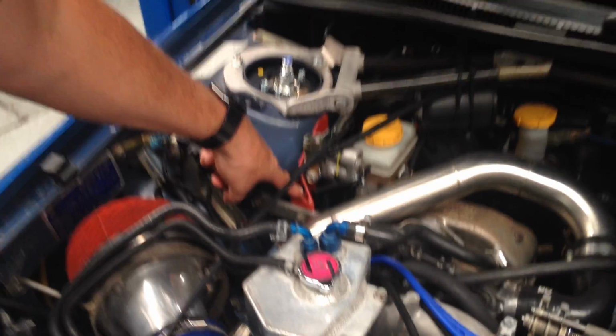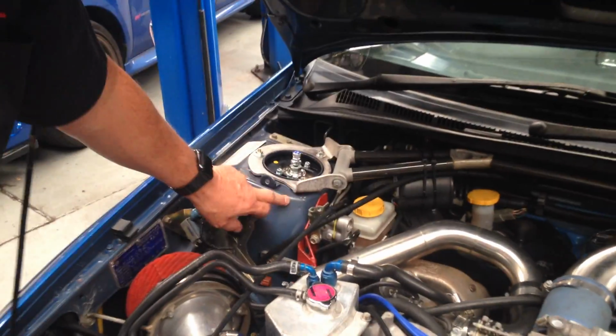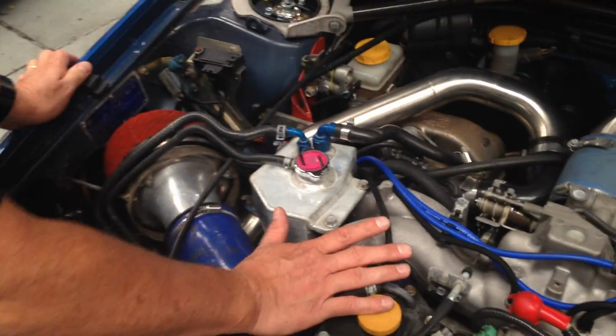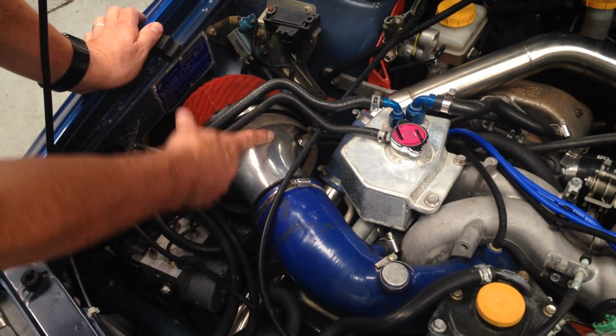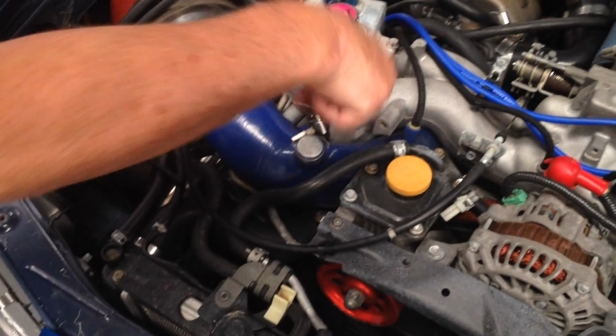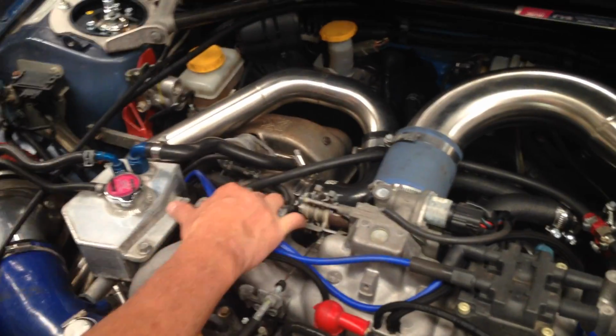It's got an MRT brake support bracket, which reduces the sponginess due to the flexibility of the firewall by dispersing the longitudinal load when you put your foot on the brake pedal to the strut brace. It's got the original GFB alloy lightweight pulley kit, and because it's got a Motec ECU, it's running a MAFless air intake. Now in those days it was quite common to run the Unifilter ram pod with the oil foam filter into a replacement silicone intake pipe into a turbo. And I think that turbo back then is probably a VF22.